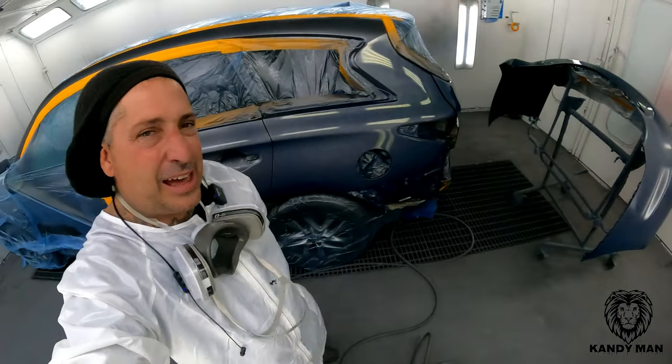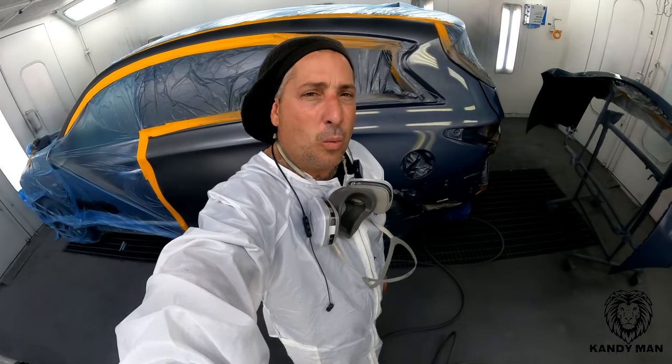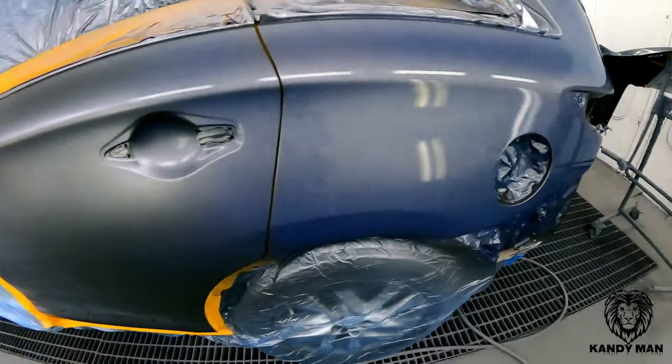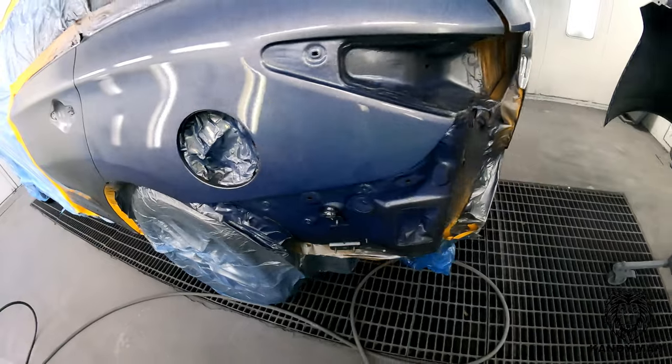On this particular color, when I'm doing these KADs, I put two back-to-back coats on. I put one wet coat, come up a little, and come right back on top of that wet coat with one more coat. As soon as this flashes up, I'll drop it — maybe have to drop it twice — but that's the last time I'll be basing it out. We're spraying the DV1 at 14 PSI for the coverage coat.